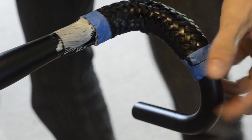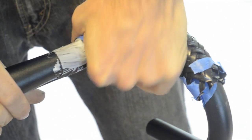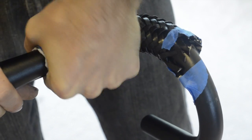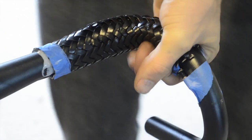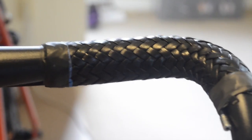Now if you make the same mistake I'm about to, don't fear. Just grab some masking tape, smooth out the ends, and do a temporary patch with tape. Once the inside edge of your grip is placed where you need it to be, tape the inside edge with electrical tape and slick from the inside to the outside end of your bar with your hands, flattening the grip all the way.